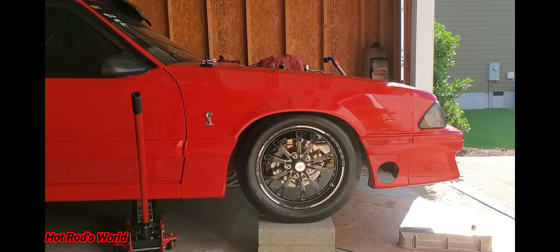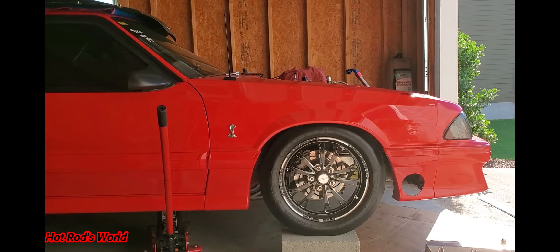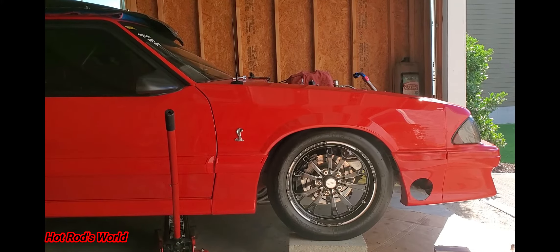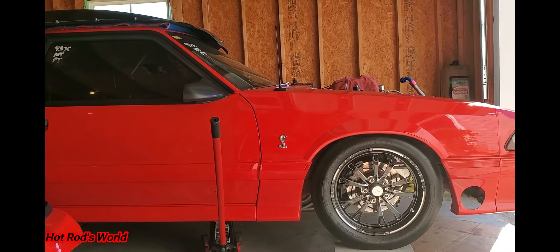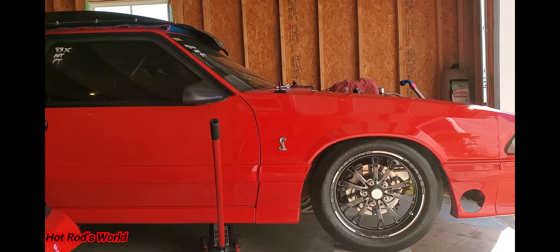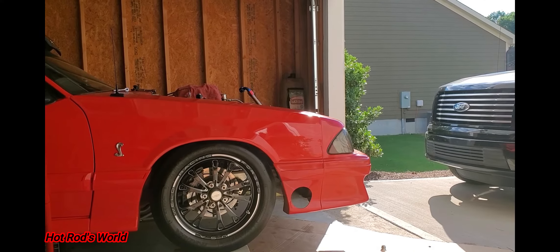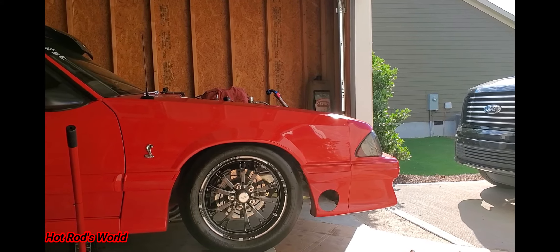While I've got the valve covers off I'm going to run through the valves too. I'll put them back up to keep dust out, but I'm going to bump the motor over and inspect the springs — since I did hit the rev limiter a couple of times I just want to make sure. Last time on the other motor some of the inner springs were broken — they're kind of hard to see. Mile-per-hour and ET will determine if they're really broken or getting weak. Plan is to take them off over the winter and redo them since they've been on this motor for about two years.